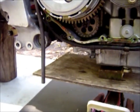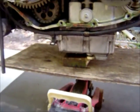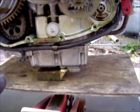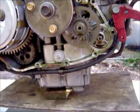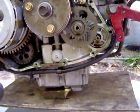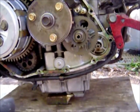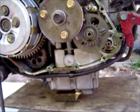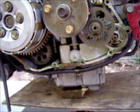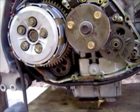I need to remove the side stand, but other than that the castle nut has been tapped off, I need to get this bolt off, and there's one other bolt on the other side and the engine is gonna drop right down. The reason I'm doing this is because I could not find that bolt that the previous mechanic dropped. Somebody sold this bike because they couldn't afford to fix it — they got an estimate, and during that process the mechanic dropped the bolt into the engine, and it was strategically placed in a manner that you couldn't grab it.